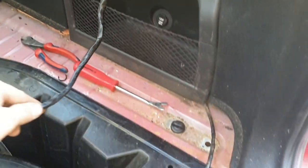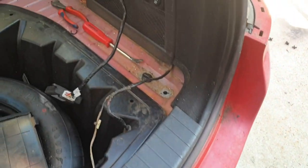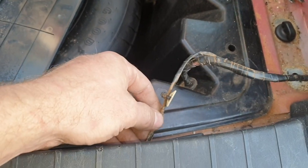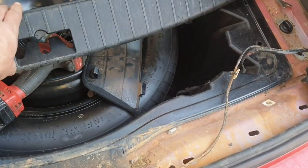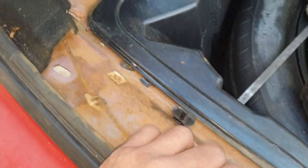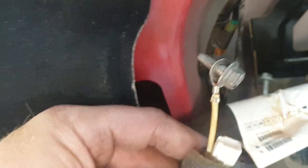There are some things to consider when you're wiring up your tow bar. What I'll do is cut it down to the plug here because I've got plenty of length for the next car to install it on. There was another part of the harness that runs across — I just pulled that cover off, it literally just pops off, there's a couple of clips. The wiring harness runs across to the other side — it must be for another option because it's not plugged in except it's earthed. So just an earth wire running across — just another part to think about.